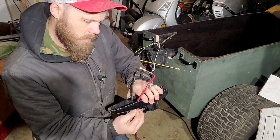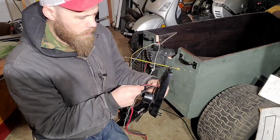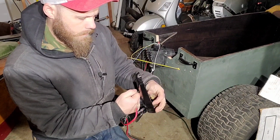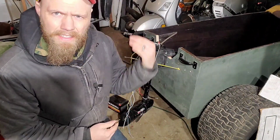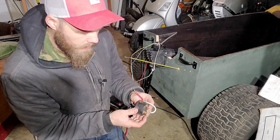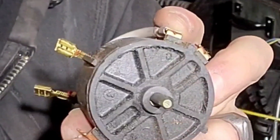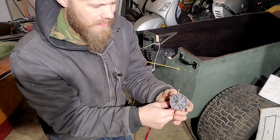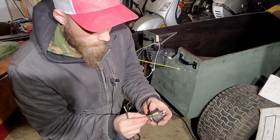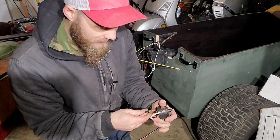These are your main wires from the battery. You have to pull them through one at a time because they're so fat. And then you get rid of that. Sharpie doesn't show up very good. That's okay because guess what? It says negative right inside there, positive right side there. So I'm going to put red on the positive side and black on the negative side.